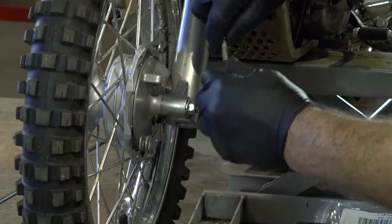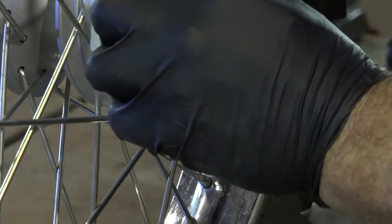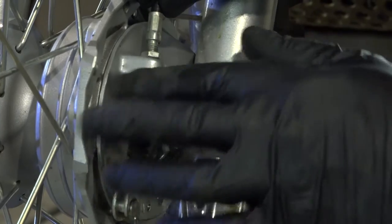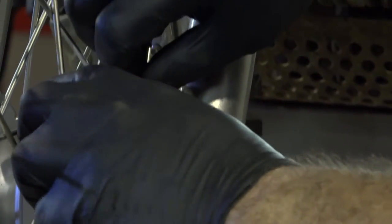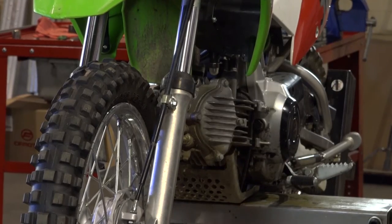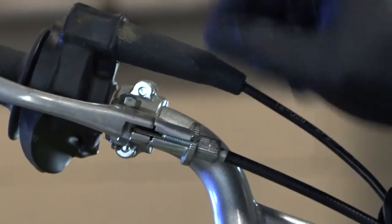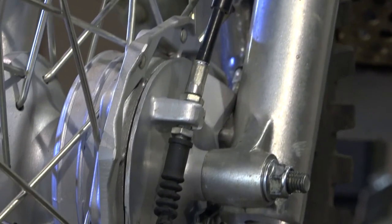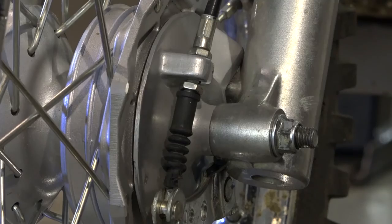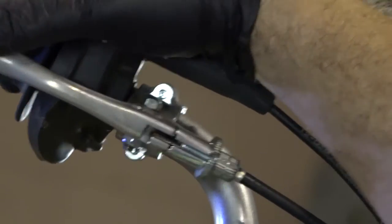Next, let's go ahead and get your brake cable routed back through. First, run it all the way down, get it into that arm, then back in. Before we tighten that down, leave it loose for right now. With that in place, let's go ahead and get this little clamp back on. When putting that cable back in place, it is absolutely imperative that you adjust this all the way up to get it to stretch back in there with a new set of brake pads. Let's zero that all the way in, and we're going to adjust this back out to give us our starting point. That's about where we want it because it's engaging right here.